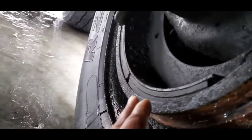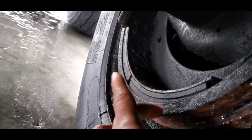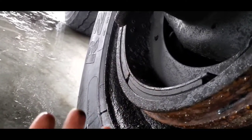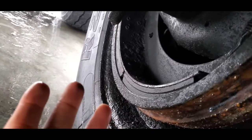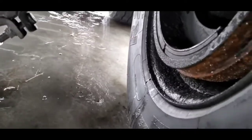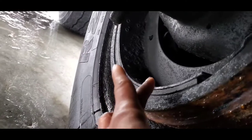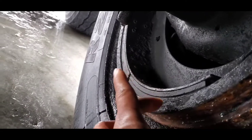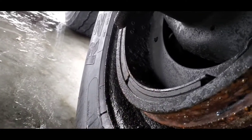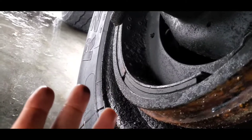Another way your brakes can freeze up is by your brake drum. To prevent your brake drum from freezing up, whenever you finish your trip and you stop, do not apply your trailer brake right away. Wait about 10-15 minutes for the moisture that's in between your brake drum and your brake pad to either evaporate away or freeze first. Then you apply your brake.